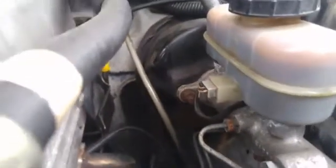The brake booster inside the car and out — I already checked inside and outside and there is nothing. Sometimes on the back of the intake you can find some fittings. There are a couple of fittings back there that could be leaking. These old 5-liters had quite a few vacuum lines.